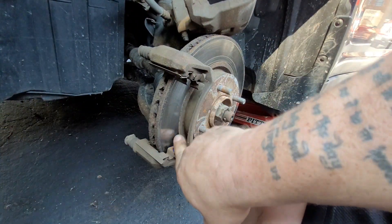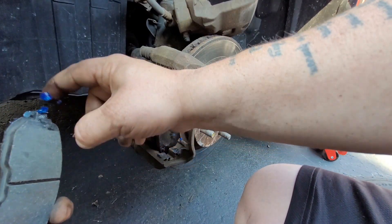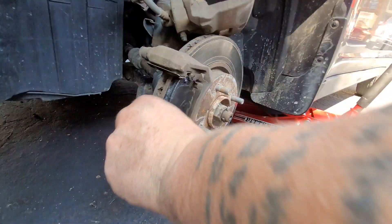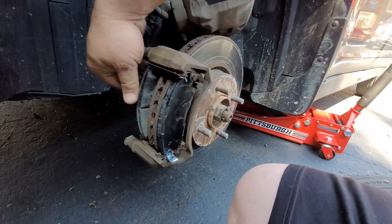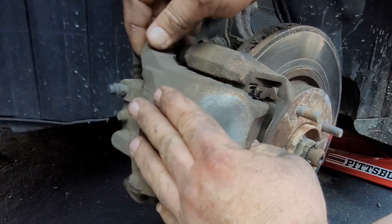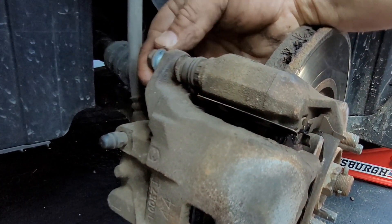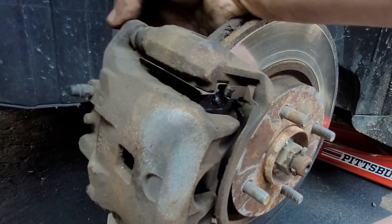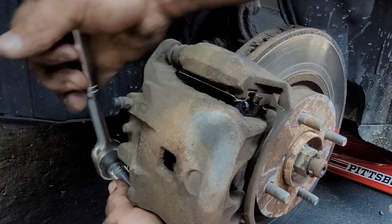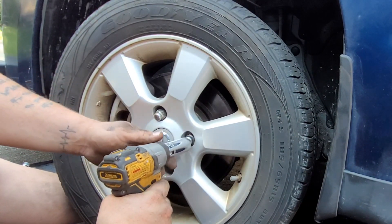The kit came with some brake grease this time, so we're going to put it on all the hardware on the caliper bracket. Also put it on the ends of the brake pads so it slides in better and doesn't make any noise when you hit the brake. Slide it in like normal, get your front brake pad in, back one in as well. This is why we push the piston in on the caliper — so it'll go over the new brakes. Get the bolts hand tightened, then grab your socket and tighten them down nice and snug. Throw our tire back on, zip the lug nuts down, and that is it.